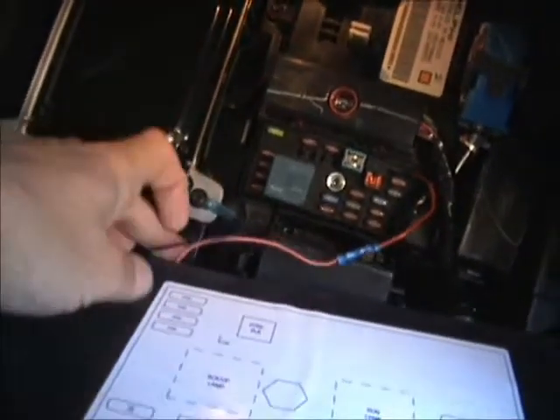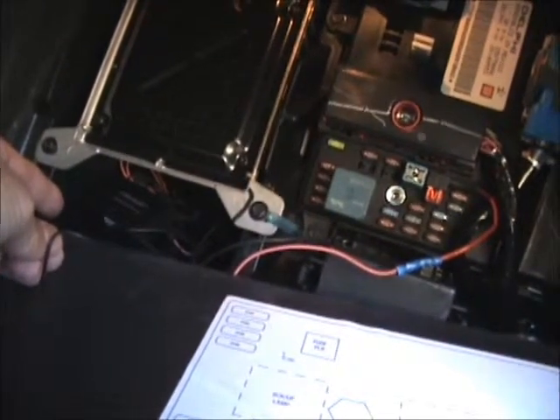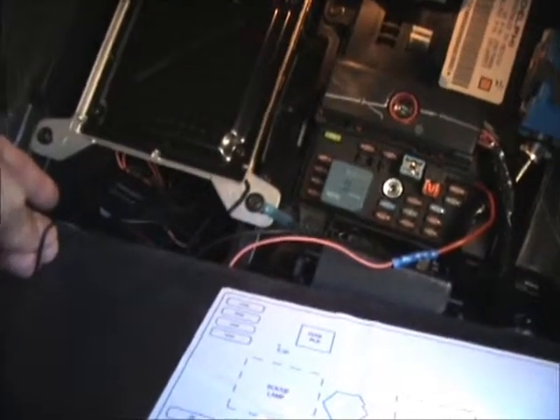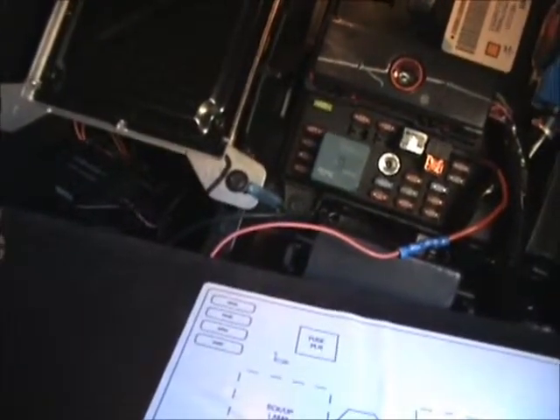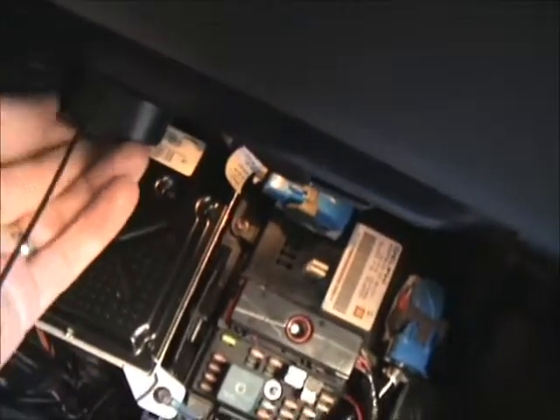There's the finished product for the Kerbler. You can see — the fuse tap goes in your seat heater fuse, that gives you your positive power, and then we've got our ground. The control module is all nice and neat, tucked away back there. We took all the excess wires — you could cut them off if you wanted to make them shorter, but we just chose to tie them all up nice and neat. We just laid the Kerbler down inside underneath the BCM. No need to tape it down — it's hidden in the fuse panel underneath the fuse board. And last but not least is the buzzer, which we're going to end up sticking right up here on the passenger side.